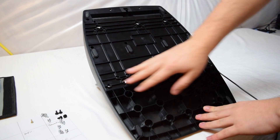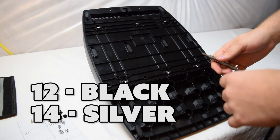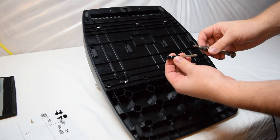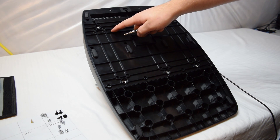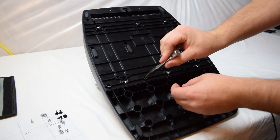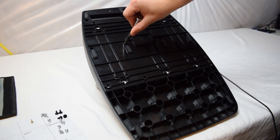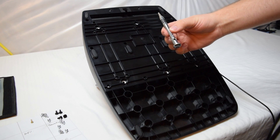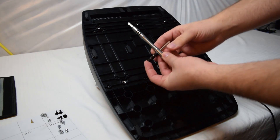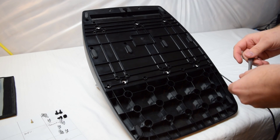Flip the pedal unit over and you'll notice a bunch of screws throughout the back. There are black screws that are slightly bigger and some silver screws, some fairly recessed — you'll need an extension to reach them. The big ones are size one Phillips and the smaller ones are size zero. Make sure you have a screwdriver that can fit down into these gaps. I'm using the iFixit Protec toolkit, which also lets you add a handle for extra torque since some screws are tight.